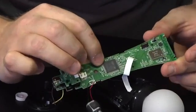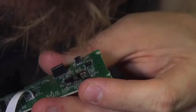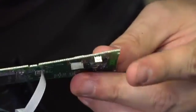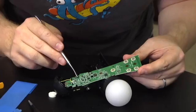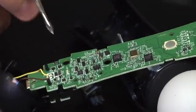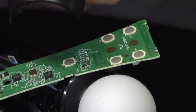This is an ARM processor so this is going to be doing all the scary math on the device. It has a maker's mark that I don't recognize. There's a bunch of chips on the other side — I would assume that some of these are gyroscopes, some of them are accelerometers, some of them are wireless chips. There's an LED right here, so that's going to be the wake-up light. These two contacts here are going to be for the PlayStation Move button.